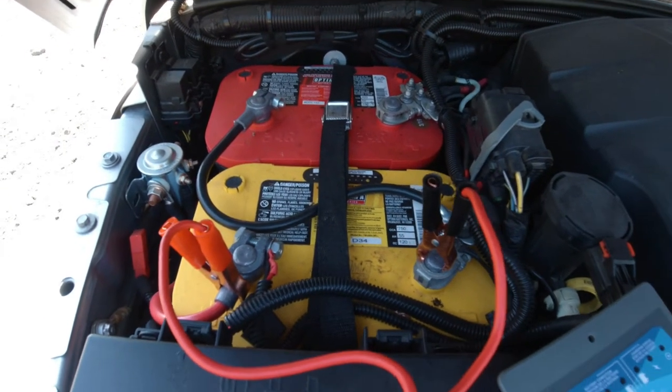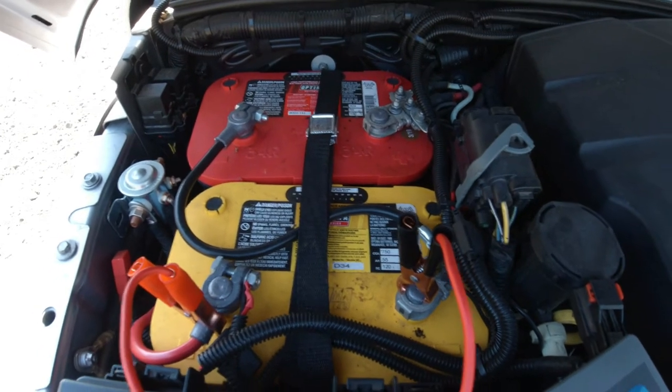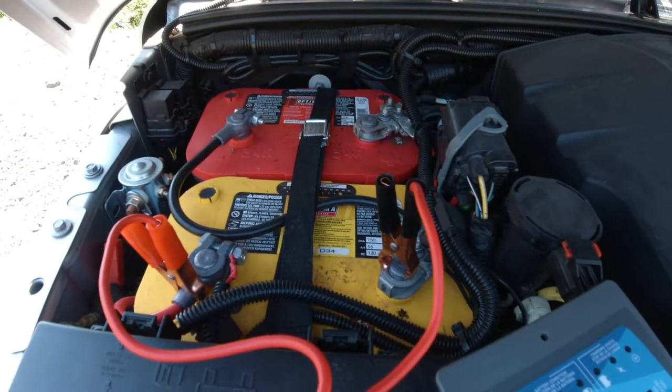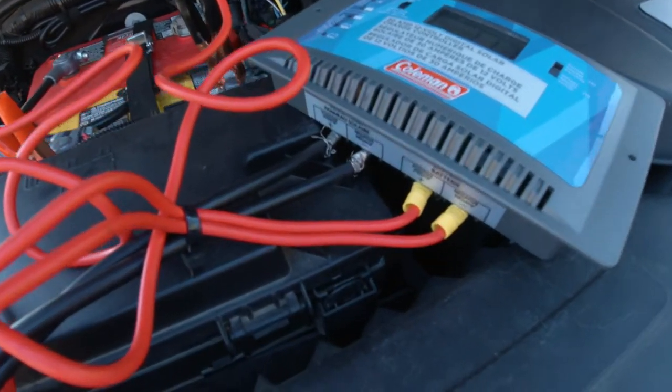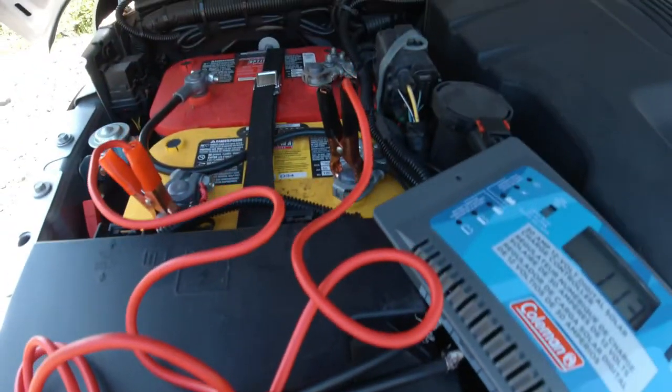This is my dual battery system. When I originally considered putting one in, everything I saw online to get me to my goal was very expensive. But after a little research I realized I didn't need any of that. My friend is an auto electric guy and he helped me out. I had to order the batteries and the dual battery tray, but he put in a new set of cables and a solenoid — that was it. Now I've got a second battery that I run everything with. I've been using it for maybe two and a half years with never a problem.